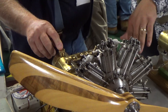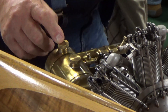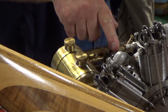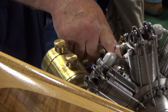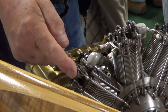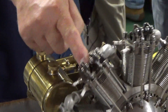There's a fuel tank here, obviously pistons, and an oil tank on the back of the fuel tank — you fill up the oil separately from the fuel, a separate tank. There's a carburetor, and the fuel mixture is fed through the crankshaft into the crankcase, up these pipes, through the inlet valve, into the cylinder.